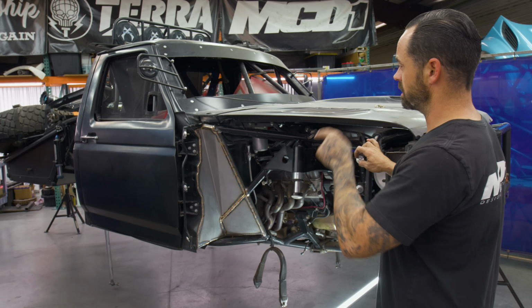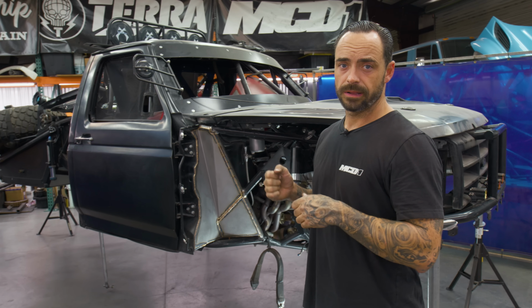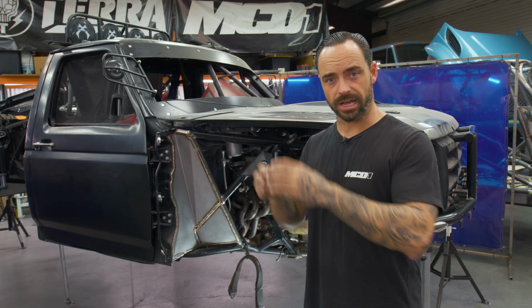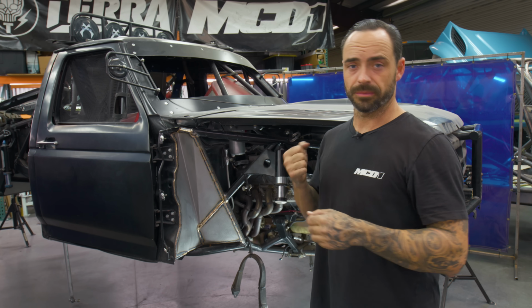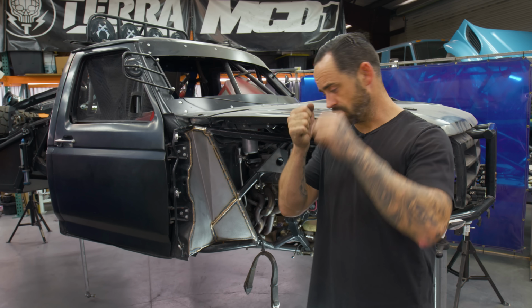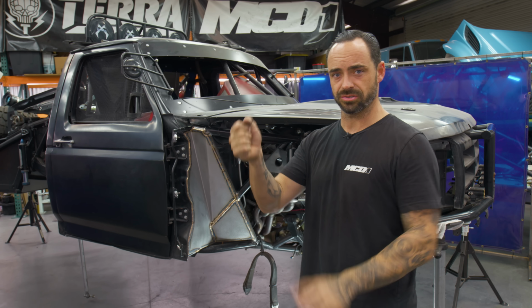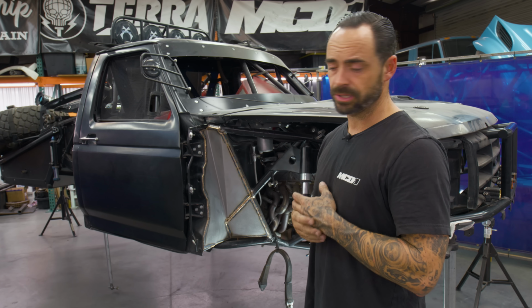Another thing on this truck we can talk about is the handbrake. They wanted to actually have a handbrake. I like a setup where there's two calipers. There's a redundant rear caliper just for the handbrake, so you're not tapping into your plumbing on the actual foot brake. You're just doing a handbrake with its own lines going to its own calipers. It's its own thing. There's no weird pressurized issues or anything. I just feel there's greater control and predictability like that.